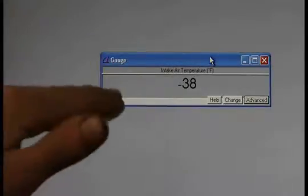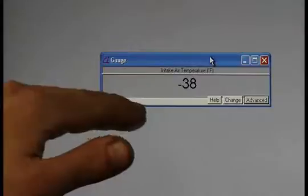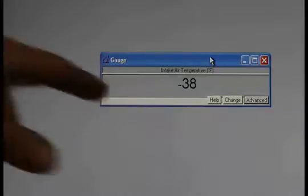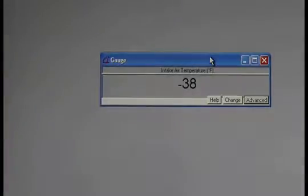But what I really wanted was a PID for voltage on here because it would have been easier to look at voltage. And admittedly, I'm a little worried about this because normally, when the sensors are bad, I see them short out, so you would read like 140 degrees. But I'm going to show you the real quick scan tool method to do this. When I unplug the sensor, then it should change. But I don't think that's going to happen because of this open situation, so it's probably not going to change. And that's kind of a problem. All right, it's unplugged. And it didn't change.